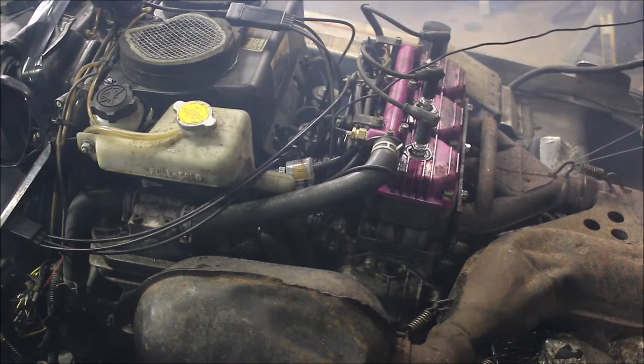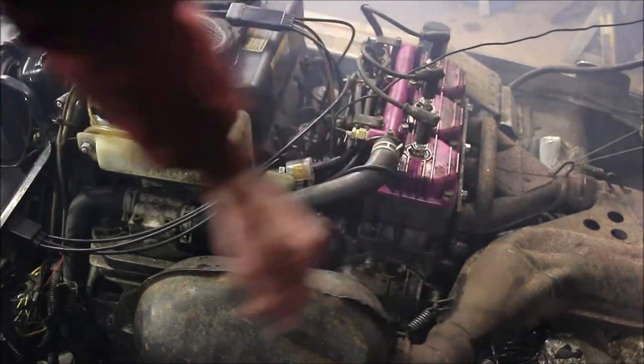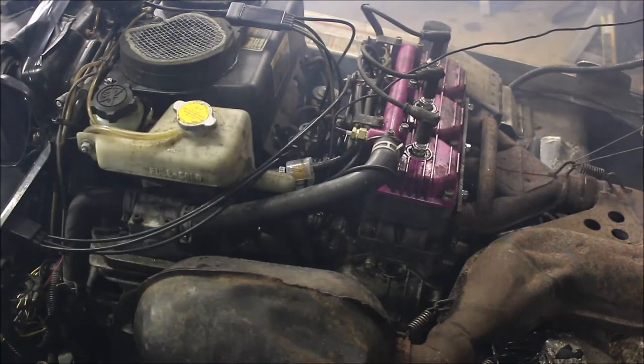Turns out the '96 Polaris 680 Ultra is known for the water pump going after about 3,000 miles on it. What you're hearing is the bearings and the gear whining or whistling. I don't have any leaks anywhere, so I know I'm good there. But I ordered the part and I'm going to take this apart and show you where it is, because it's mounted to the front of the engine. I'll have to remove the exhaust to access the water pump. This thing's been sitting for five years, so I'm guessing the bearings probably got a little rusty — they're probably squealing on the shaft.